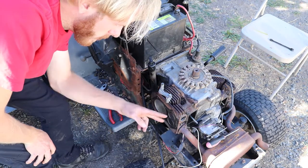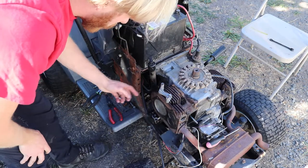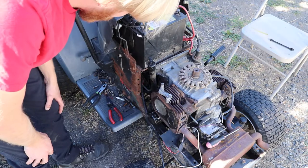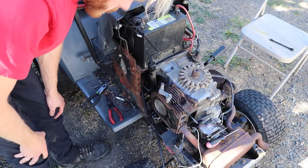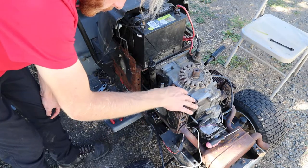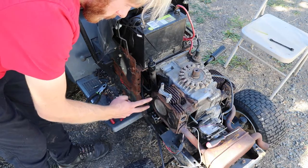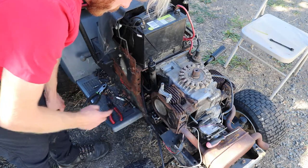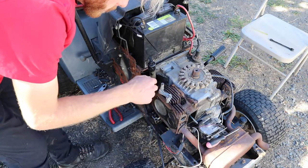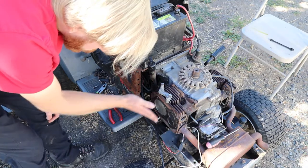Obviously the valves are being pushed on a little bit, so it's gonna have some spring back, but I'm gonna go ahead and run all these nuts on. I'm actually gonna do that cylinder and then this cylinder. I'm not gonna record that. I'm gonna get them pretty tight, going from the inside out. I can't find the spec and you can't really get a torque wrench in here, so I'll probably do it in two steps, maybe three, and maybe let it sit for a little bit and then come back and do it again. So I'll catch you guys when that is done.